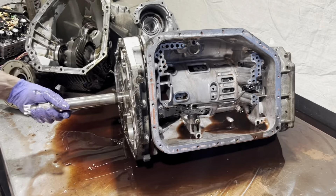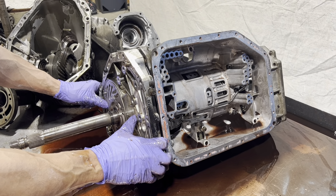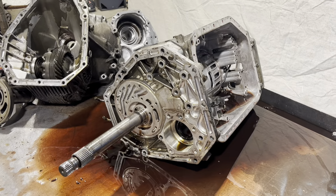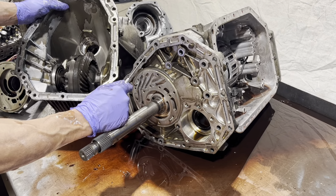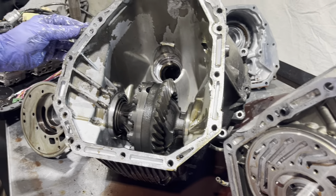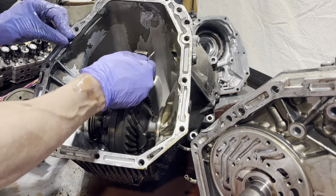What's typical with Subaru 4EATs and 5EATs — this stuff is kind of hard to take apart sometimes. There are dowel pins that get rusty and various other reasons, but they're kind of a bear. Now this is something important: we have a little rubber seal here, and this sometimes stays in this side or sometimes stays in the other side.